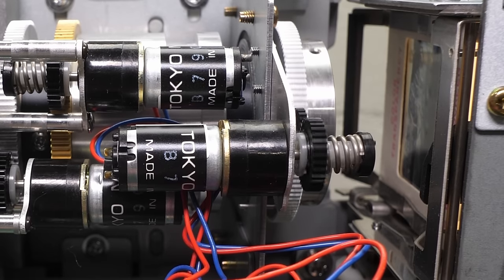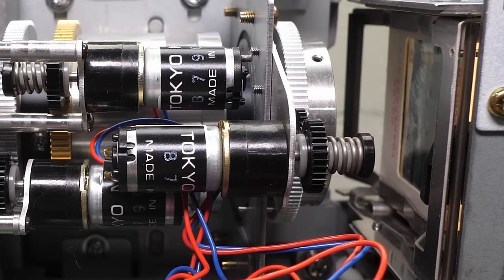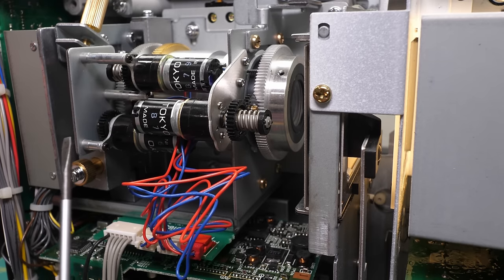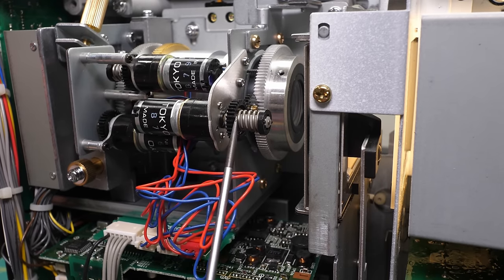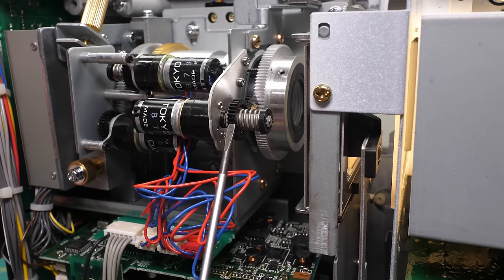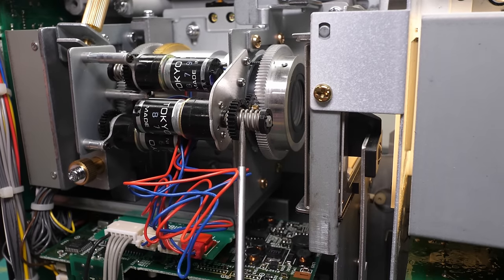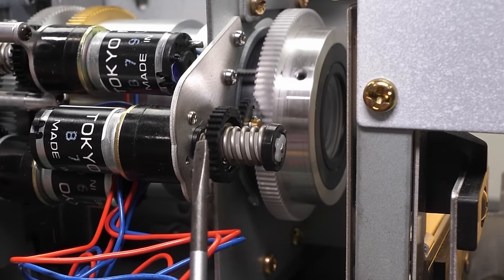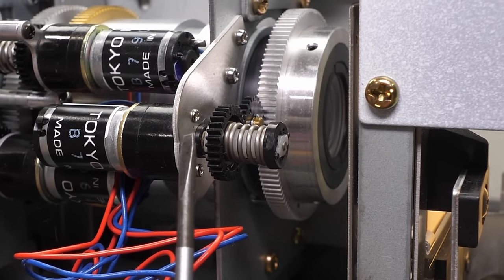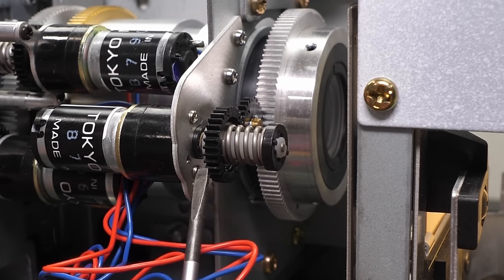With the computer integration being so limited, in practice you'd mostly have operated this thing by hand. That lets me segue into a neat feature of this and probably many other consumer video camera lenses. These motors are generally referred to as servos — but while that word often implies a feedback mechanism that would let the computer know where each lens ring is positioned, this has none. That's why there are no serial commands to zoom or focus to a specific point — the computer doesn't know where any of the controls are or even where they aren't. It doesn't even have limit switches, which means this system has no way to stop you from running these motors even if the lens has nowhere to go. Fortunately, they accounted for this — when the lens hits the end of its travel, it stops spinning but the motor keeps going because it has a little tiny clutch.